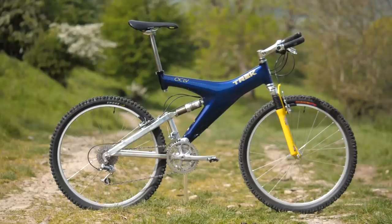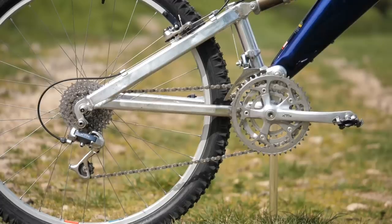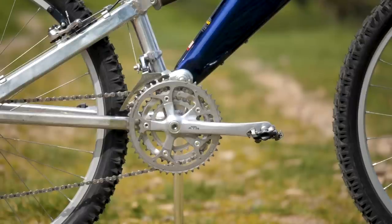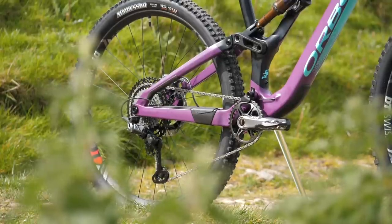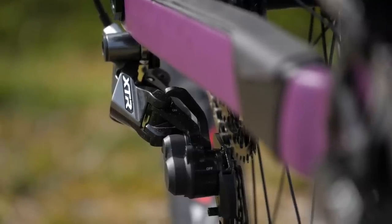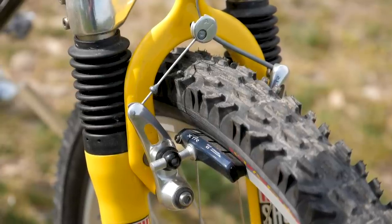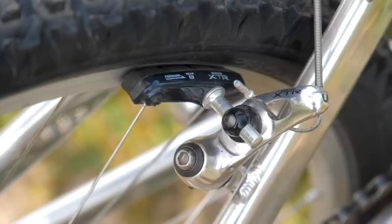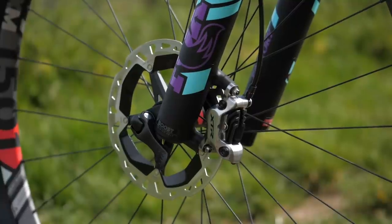Let's take a quick look between the original '92 XTR and the modern 2019. First up, you've got a triple chainset up front with a front derailleur — you don't even have those things anymore, two at most. Out back you've got eight gears, whereas on the modern one there's a massive spread. It's a one-by, which means one chainring up front and a whopping 10-51 selection out back — you can climb up a house with these things. And of course you've got a clutch derailleur, which means the chain can't come off and it's nice and silent.